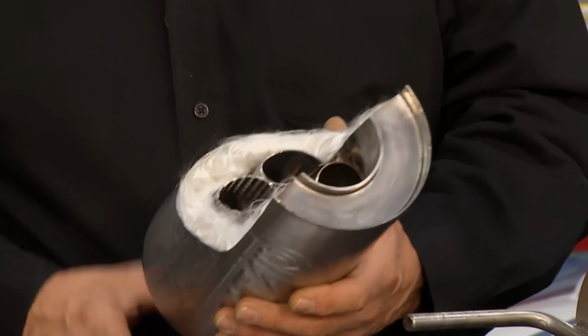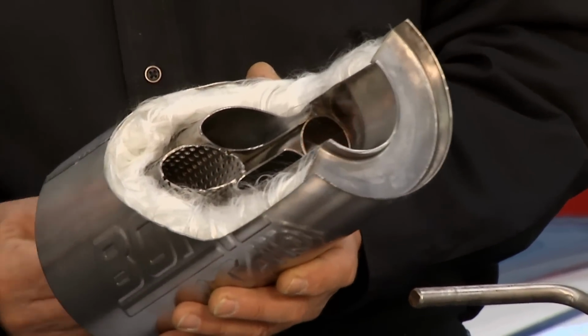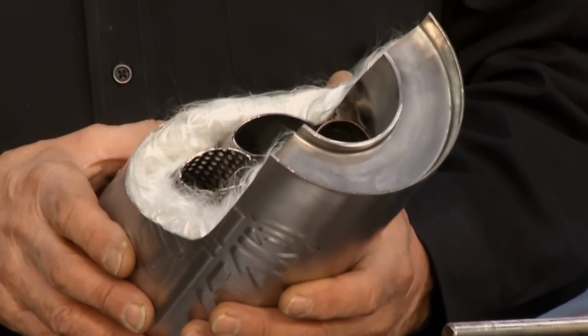So what you have there is a muffler, and it's actually from another application, but what you see here is a straight-through core design. On the original equipment mufflers, just like on this Mustang, there's actually 3 mufflers on the Mustang. They all have baffles inside of them. This one doesn't have any baffles. Everything's going to be straight-through core. Now, this is going to be very aggressive. This is the attack. That's why you only have 1 tube right there that has the perforated holes.